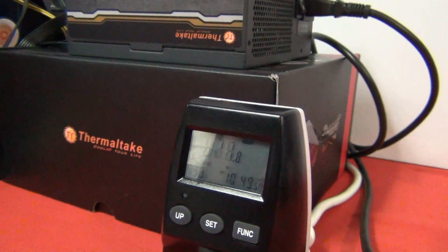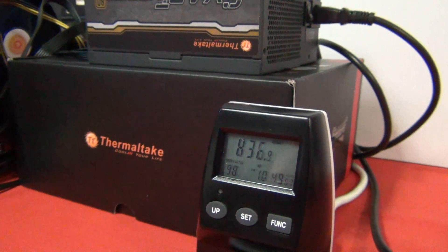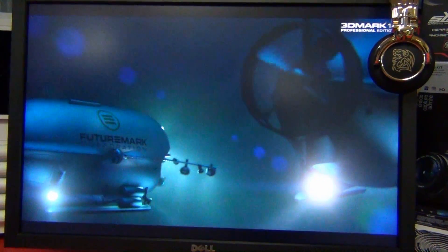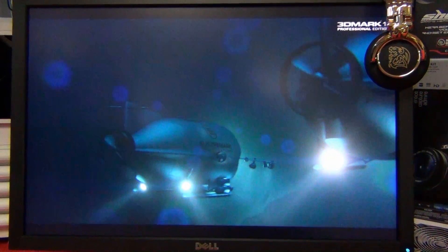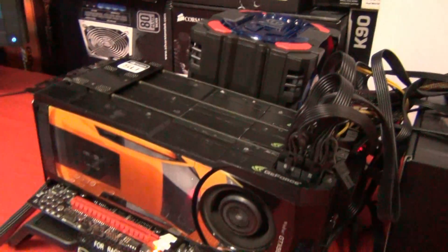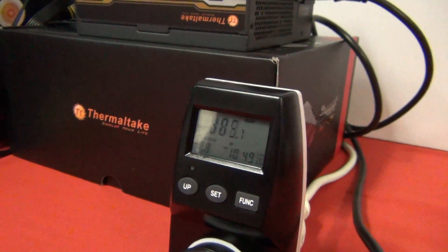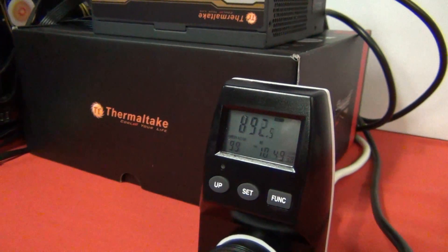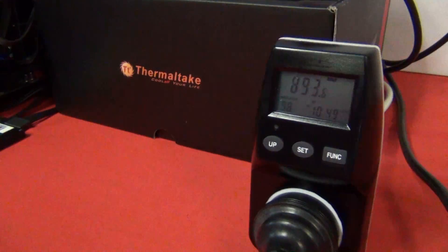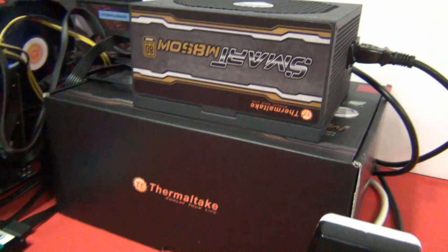According to Thermaltake's website, the PSU can do around 1025W at peak. We're currently at 830W in the test. We'll see if we can push it past its rated 850W — it's operating at around 30 degrees in this room. Now it's drawing 863W, about 862W. We're at 900W now. Unfortunately I don't have a fourth 580 available, but I have no doubt this unit could reach its stated peak wattage under a heavier load.